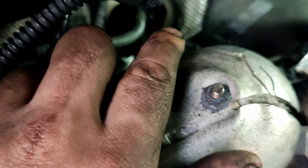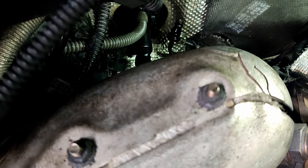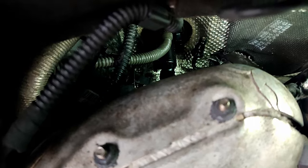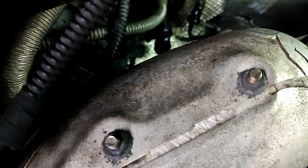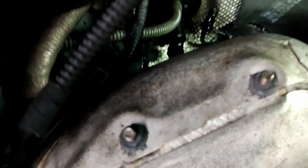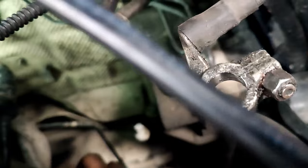You can see down there I've got the hose out. Check the top of it — make sure the O-ring is still in there. That's really important when you put it back. I've pulled this hose over a bit just to get it out of the way. To get this off there's a little spring that holds it — you need a small screwdriver to pop that out. I had my left hand down in that hole pulling down and my right hand wiggling the hose from this side to give a bit more leverage to break it free.